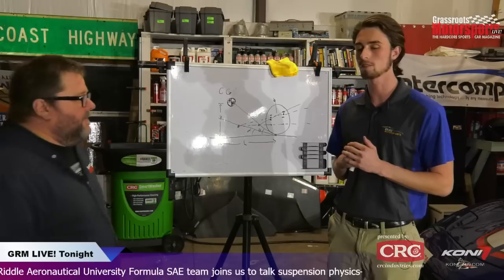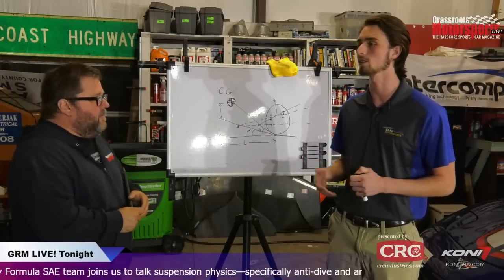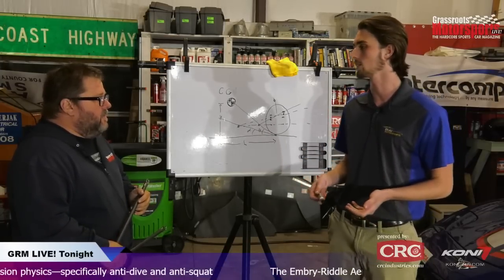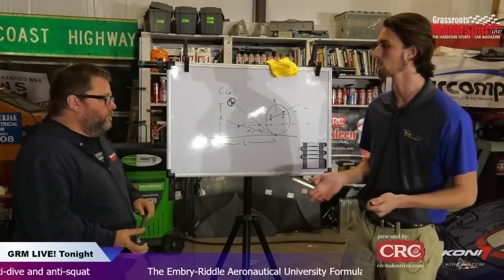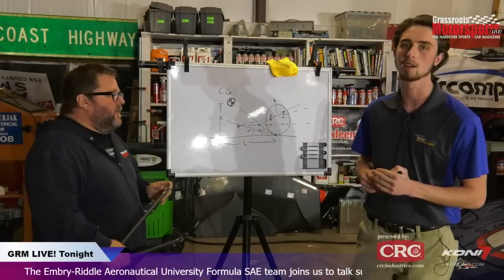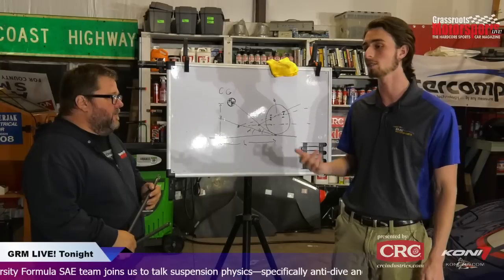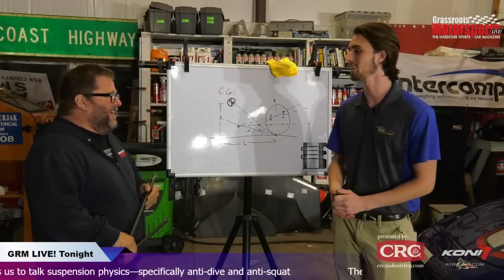So there's a lot of stuff like that that plays into driver feel. Again, some may prefer a slightly understeering car, some might prefer a slightly oversteering car, and then you have steady state oversteer and understeer, and transient oversteer and understeer, which is basically your corner exits and corner entries. So yeah, driver feedback is hugely important for us. That's probably the main method of tuning, really. I'll put a setup on the car that I think it should drive like, and if they come back and tell me that they don't like it at all, that they can't drive it, then we have to find a different setup.